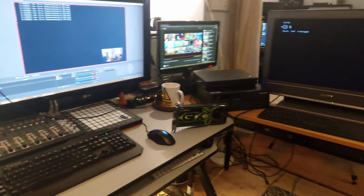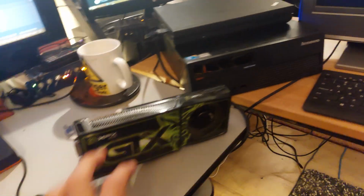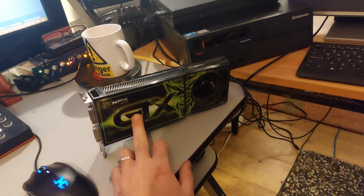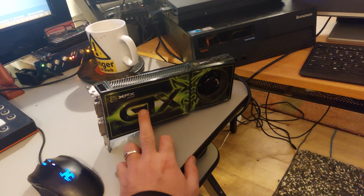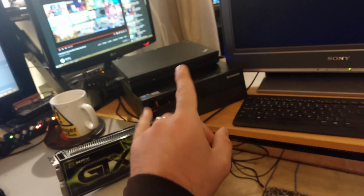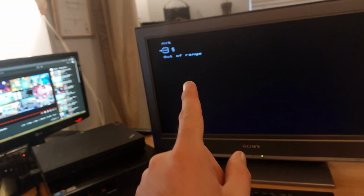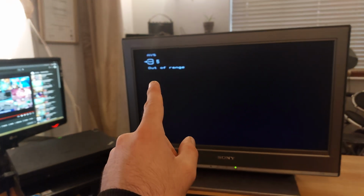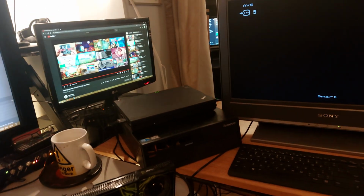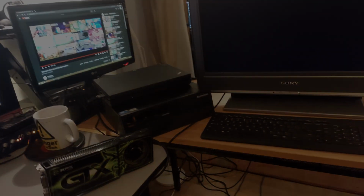So after much faffing and watching of LGR videos to pass the time, I believe I've got a long beep and 2 short beeps, which means incompatible display adapter or graphics chip with the eGPU with the X200. However, I've got a GT710 that appears to sort of, kind of, out-of-rangeily be booting, and then it just goes to sleep. So I'll be back with more information.